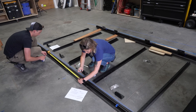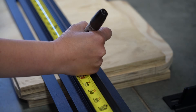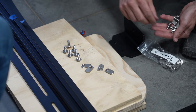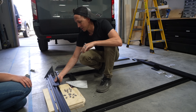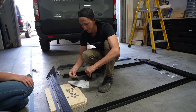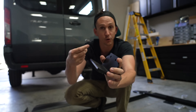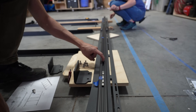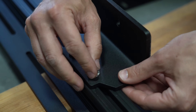The instructions for the rack show where approximately the roof mounting feet need to be positioned, so we measured out where those will go and marked them with some painter's tape. These can be adjusted as needed later, so we're just going for pretty close at this point. The next thing is to attach the mounting feet to the 8020 in much the same way that the side plate mounts on the other side. These mounting feet have rubber on the bottoms already, making it pretty waterproof, although we will still use sealant over the top. We slid the T-nuts into our pre-marked positions, put Loctite on the bolts, bolted the mounting feet to the inside of the 8020, and tightened them to just past hand tight so we could adjust them further on the roof if needed.